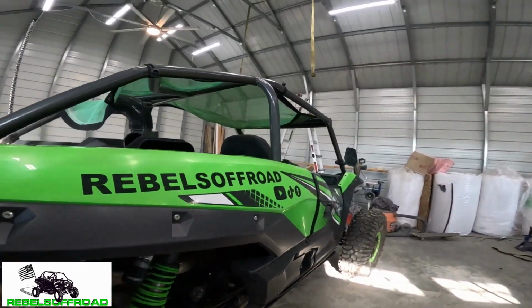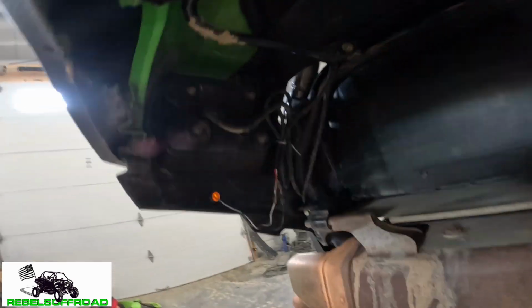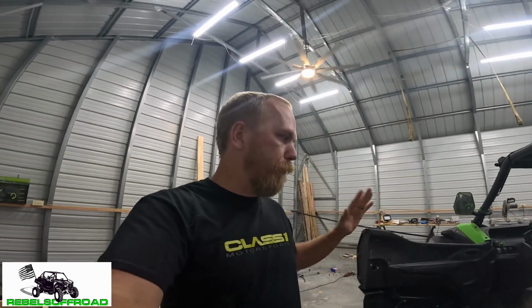And then for the turn signals and stuff like that, I already mentioned I do have the turn signal kit already installed on my machine. I made a video about that, you can check that out, but you might think that I might be tying into that kit, and actually that's not the case. The controller on these whip lights needs 12 volt positive, and my blinker kit that I have already installed actually runs on the ground side of things. So essentially it won't work just to connect it into the blinker light.